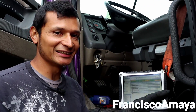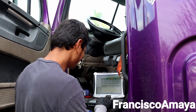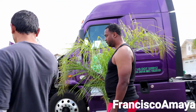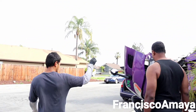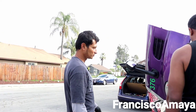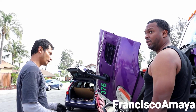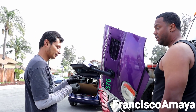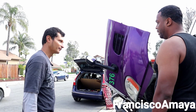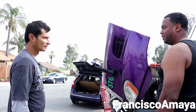So this case is dismissed — there was a little blockage and it's clean already. Everything else is fine. Just make sure to replace the air filter, because a dirty air filter can cause problems like this too. But it was clearly an obstruction on the EGR delta pressure sensor — nothing to do with the DPF filter.